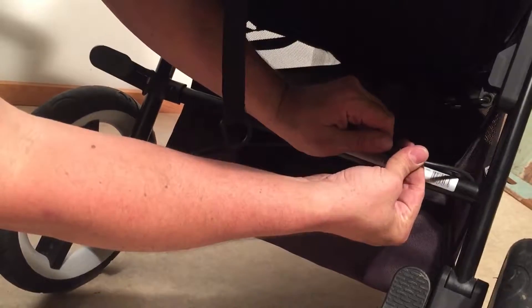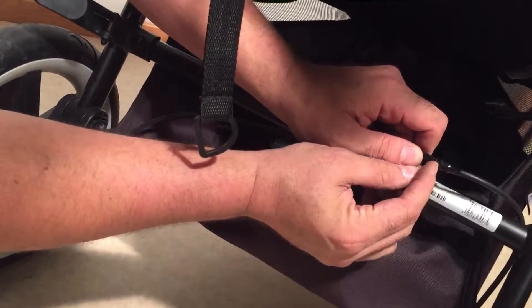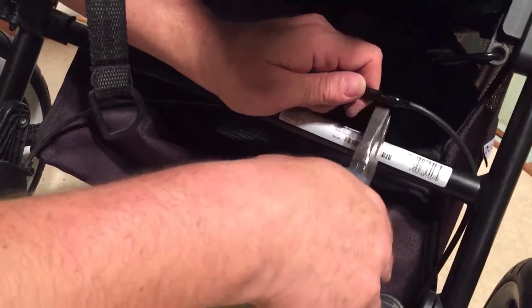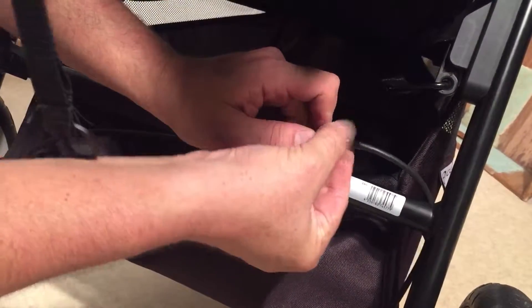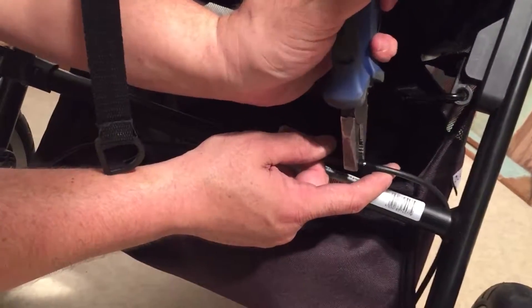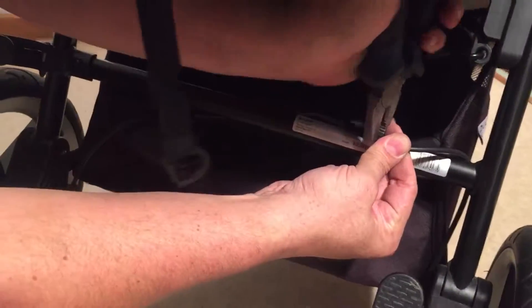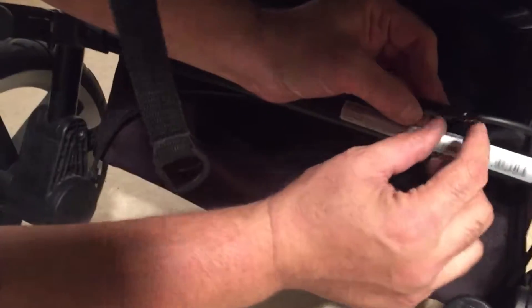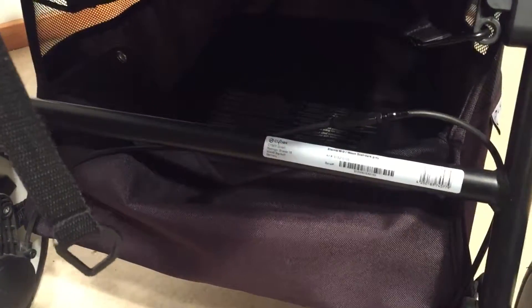If you screw this tighter — you do this by twisting it apart and then taking this nut and screwing it down — what this is essentially doing is elongating the outer bit of the brake line. This puts more tension on the inner brake line inside the plastic housing, causing the pin to extend out more. Now it's in an extended position and the pin will stick out more on this side, causing it to have a little more traction and allowing the left side brake to be a bit tighter.